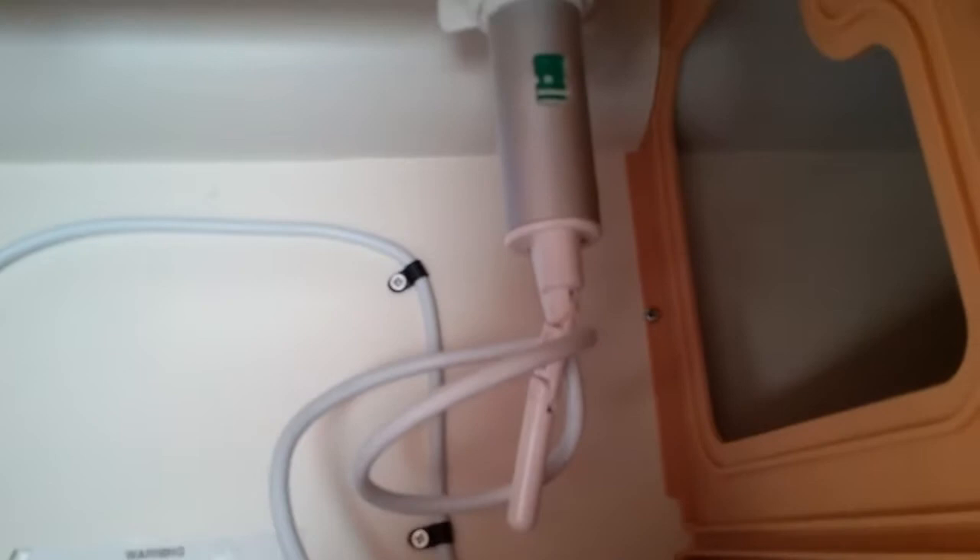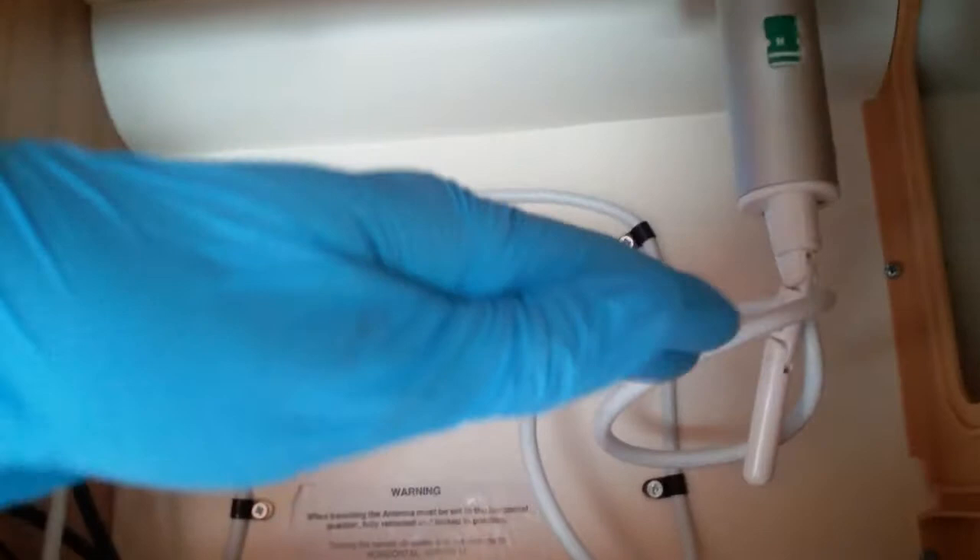If we need to do additional tuning, the aerial is currently set to H for horizontal — we can flip it onto its side into the vertical position. We just turn the tail here to do that. Do make sure the aerial is down for travel, and do not over-tighten the collar as you can split it.